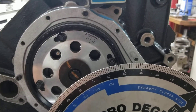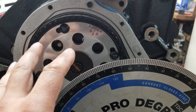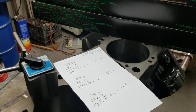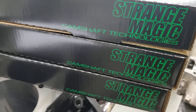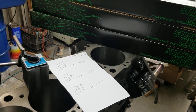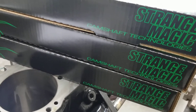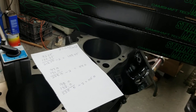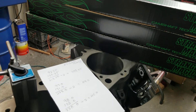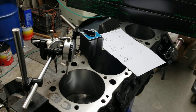Those reference marks are just that — a reference, not accurate. If the line shows two degrees advanced, it doesn't mean your camshaft is actually two degrees advanced. You have to go through the full process of degreeing a camshaft because there are lots of variables: where the keyway is located, how the timing chain manufacturer makes their set, where the pin is located in the cam. We do a lot of camshaft design here. We have our own company called Strange Magic Camshaft Technologies, with contractual agreements with three of the top grinding facilities in the country.